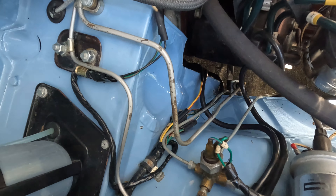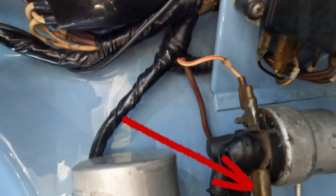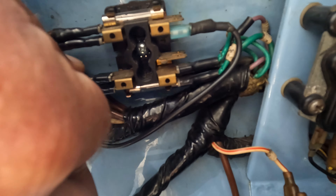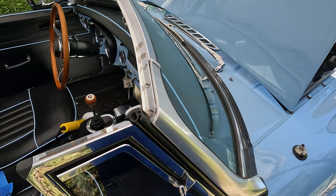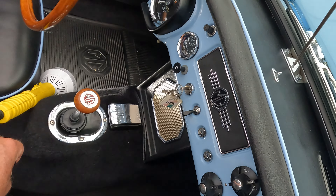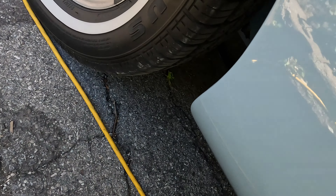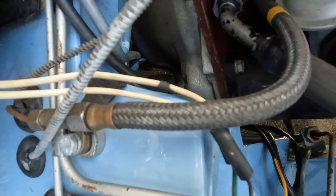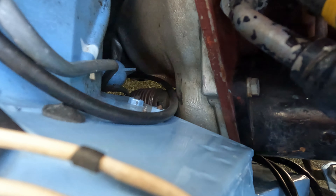You can see the cable running down by the inertia starter. I'll turn the engine over using the solenoid button located right here. I don't want the engine to start, so I'll disconnect the fuel pump — this also comes in handy for doing compression tests. If you have one of these starter solenoids fitted to your car, you probably already know there are some precautions to take prior to using it, and you usually only make that mistake once or twice before you learn the lesson. So I always make sure the car is in neutral, engage the parking brake, and turn the key to power it on.